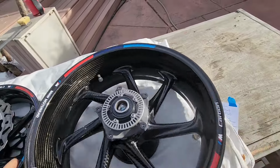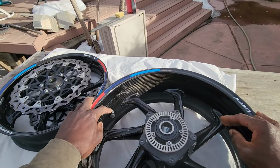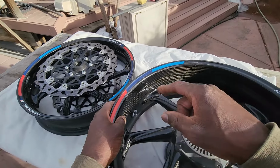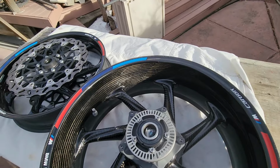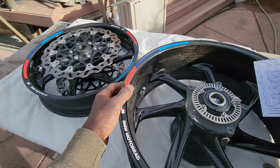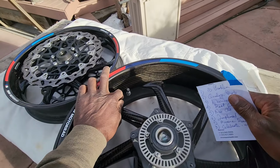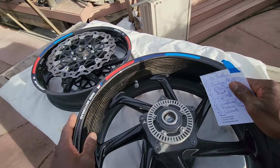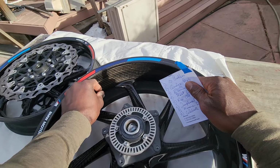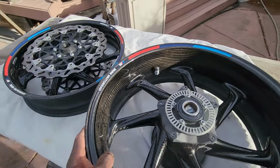Some additional testing performed by the tech at the shop confirmed that even though we had put a new valve stem on there and it still leaked, he was able to put some sealant or washer or something on there to stop it from leaking. And on further analysis, he felt the wheel was structurally fine. There was no issue with the wheel. But it's the construction of what BMW is doing. Yes, this does seem to, I don't know if it's a crack, but there's some evidence in the seam that something seems to happen.